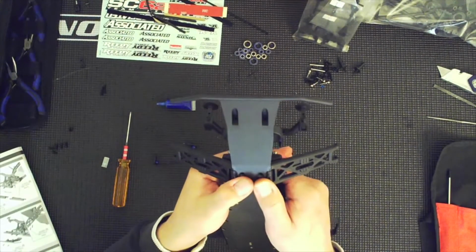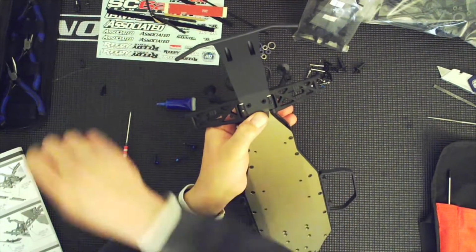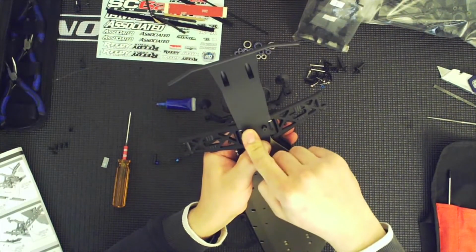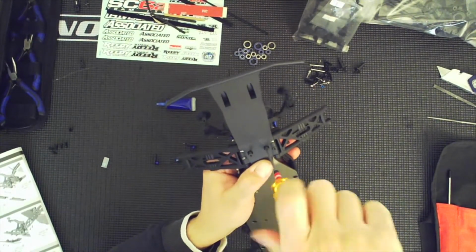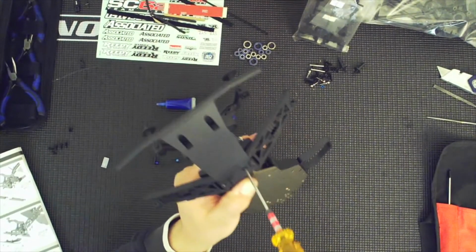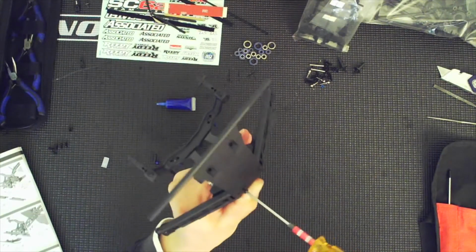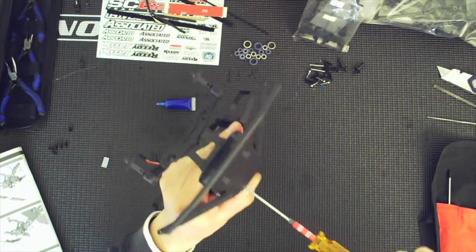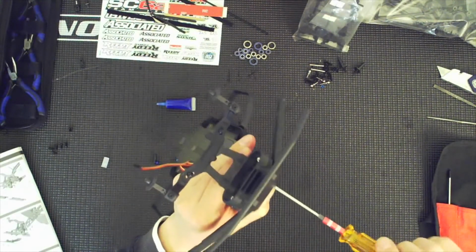And you will be using different screws for this. So in the bottom, so right here holding these, you will use 16mm screws, which are these screws. It's the long screws that you have left. You already used the 14, although the 14s were not countersunk, so these are the only countersunk screws that you will have left. And these will hold the bumper onto everything else. So this goes through the bumper, through the bulkhead. Very important. Right, that is close. And here goes this one. All right.